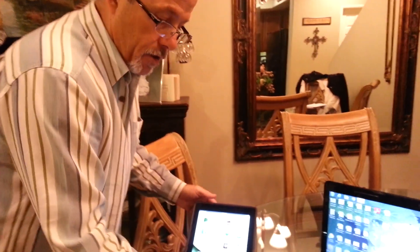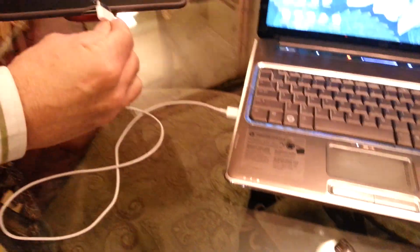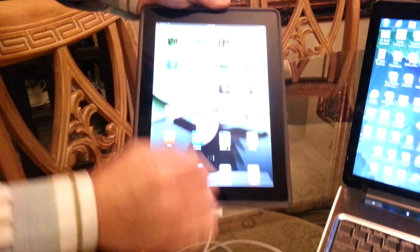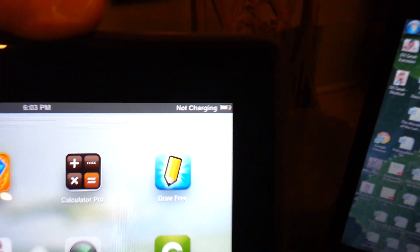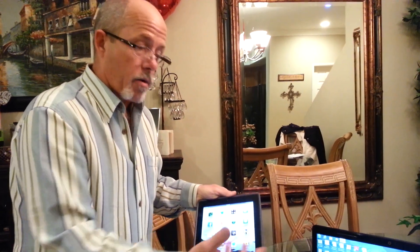Right now I'm going to show you how this works. You plug in your USB charge sync cable into your tablet, and it says: not charging. It just doesn't have enough power output. Your computer's only putting out about half an amp. This device is demanding over one amp of power, and if it's demanding it and it's not getting it, it's not going to charge.